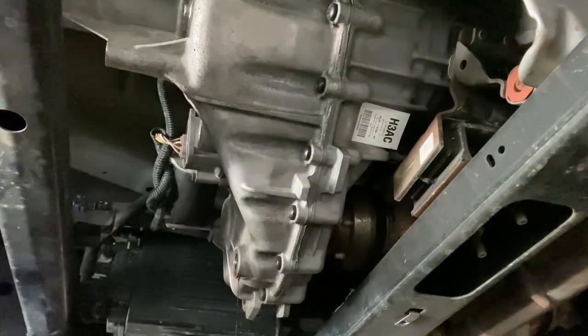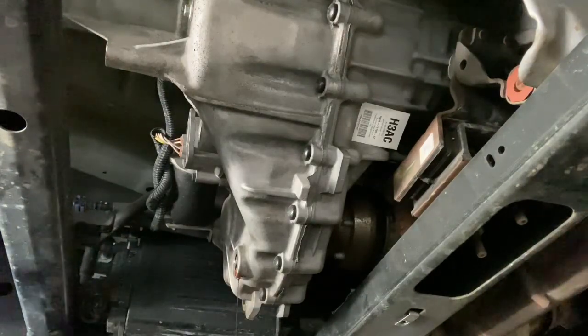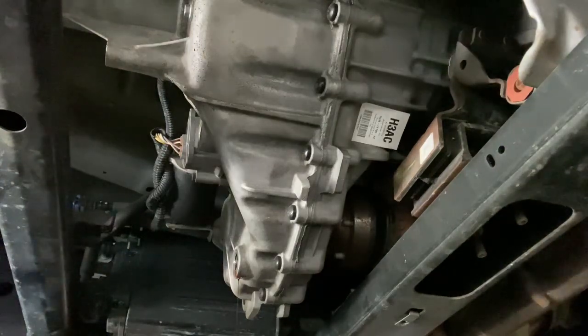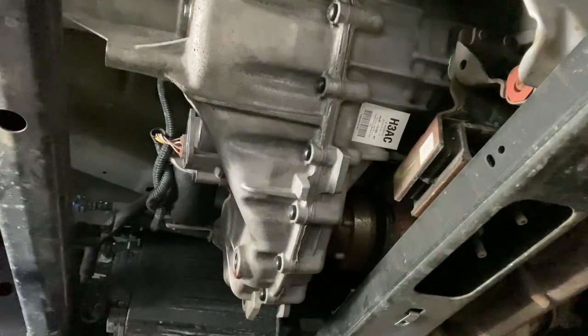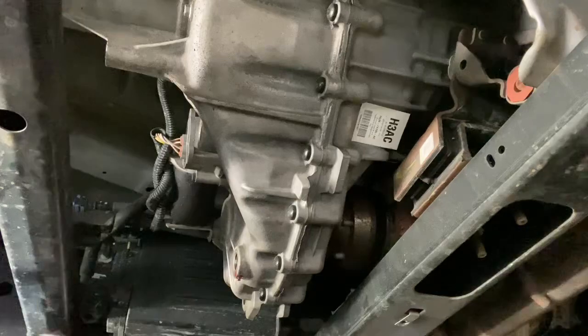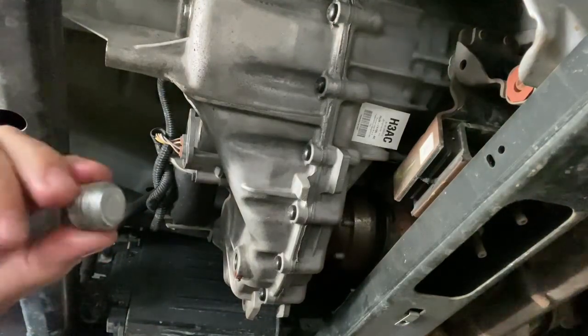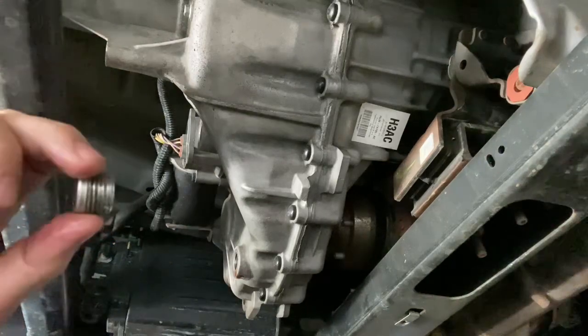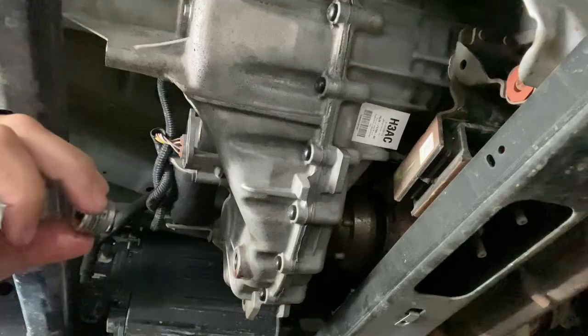The other nut has no metal shavings — both nuts are off. Once this is done draining, I'm going to put the drain plug back in, and after that it's just fill time. It's recommended you clean the threading on these with a wire brush to get the gunk off from the thread locker they use at the factory, so clean these off so no buildup occurs in the threads.